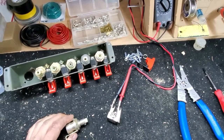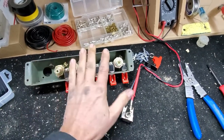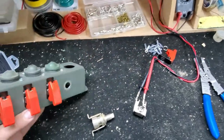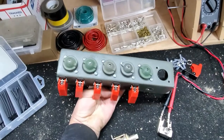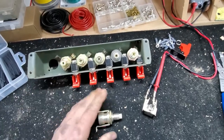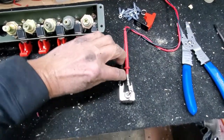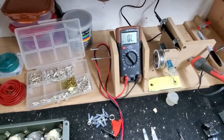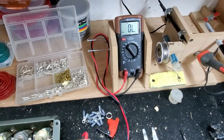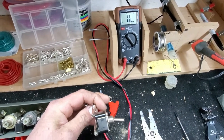I'm going to show you real quick how I'm going to wire up the light bar control switches for the cab. This is the back, and that's the front of how we control the switches. I'm starting with the first one — took it out because I have to be able to get to everything. One of the most important things is knowing the position of the switch — on or off. Using your multimeter, put it on continuity to find out whether your circuit is closed or open.